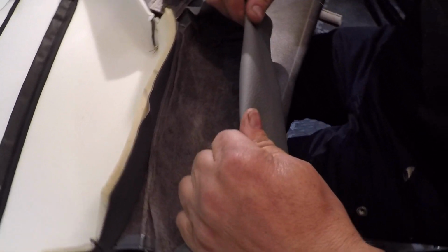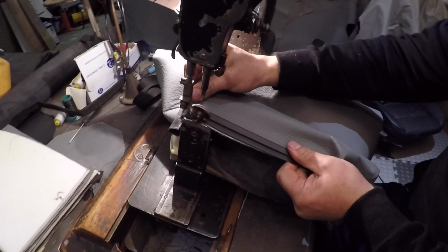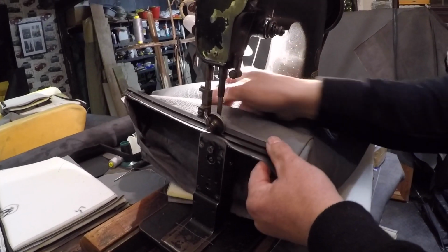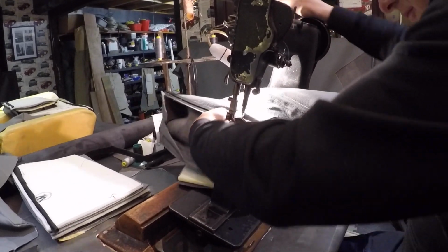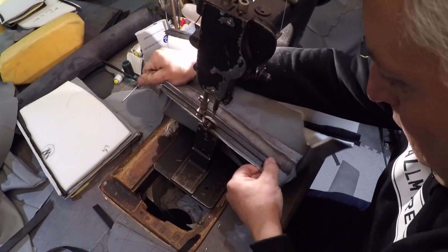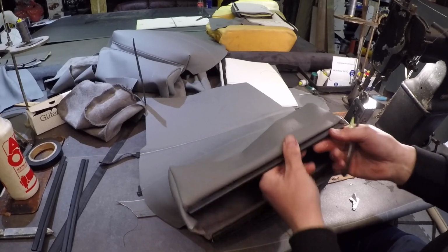The only thing left to do now on the seat covers is to attach the knee roll plastic strips. These are a U-shaped rigid plastic that allow you to fasten them to the knee roll metal frame. We took these from the old cloth covers when we stripped them down. At each side of the frame there are 2 spikes which you hook the leather side pieces to once you have carefully fitted the knee roll cushion inside.